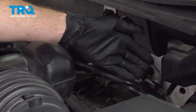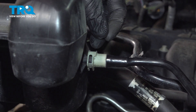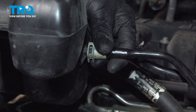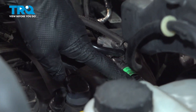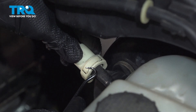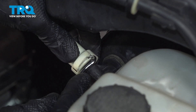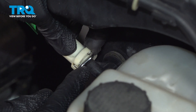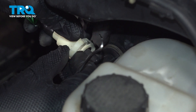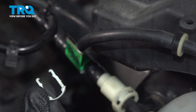In this area, you're going to find an EVAP line — it's a plastic line with a small connector that we need to disconnect. Looking at that white connector, it has a lock with two ears that you need to carefully pull out and away while gently pressing it up. To demonstrate, I can show you a similar connector with a locking tab over at the brake booster. To disconnect it, use an angle pick or a flat blade screwdriver, getting into the small grooves close to the locking ears and gently twisting and pulling up on the locking tab. Work it back and forth as needed to separate it from the line, and fully remove it so you don't have to worry about it falling.